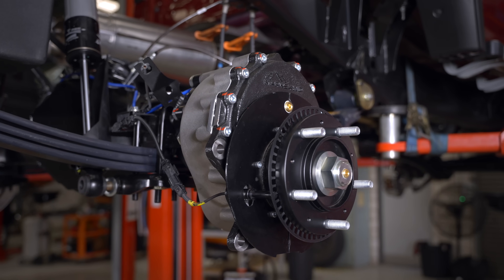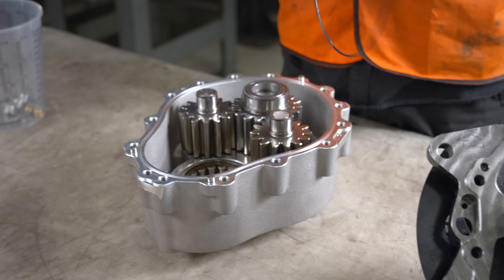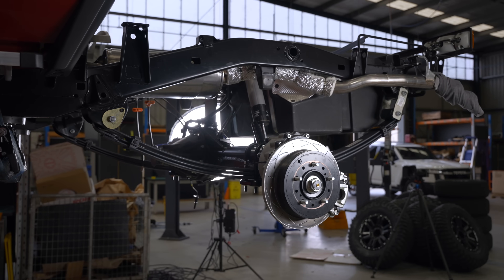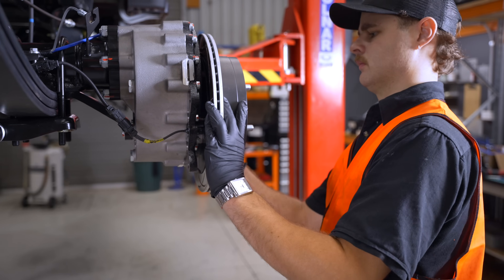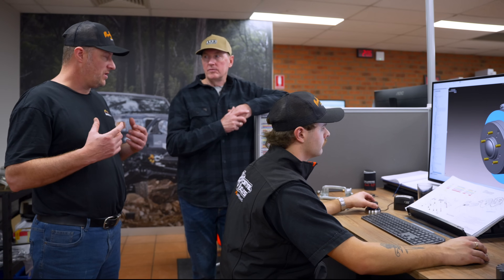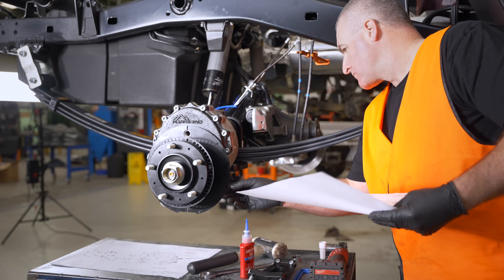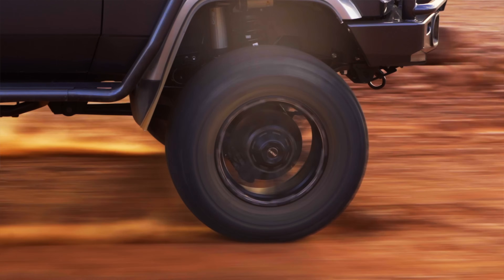I noticed the housings — they look like alloy. They are. From cast iron to aluminium — massive reduction in weight, approximately 10 or 12 kilos. We've also increased the size of it. The brake rotors look bigger. They are bigger, yeah. We've stuck with OEM fitment — they're a Bendix 200 Series brake rotor. We've eliminated the Toyota wheel hubs and wheel bearings — no original bearings. That's every 20,000 kilometres you need to repack the bearings on a 79 — you don't have to do it anymore.